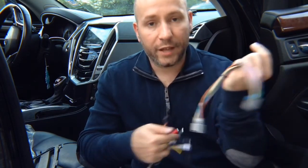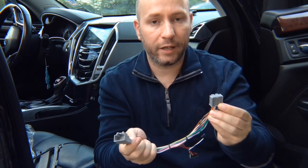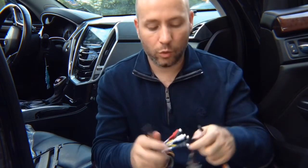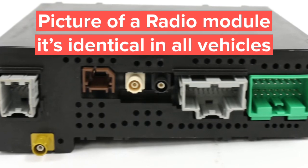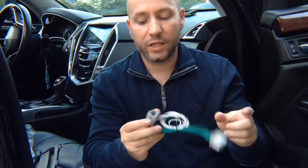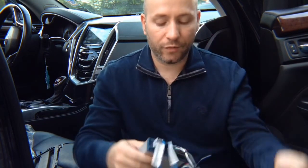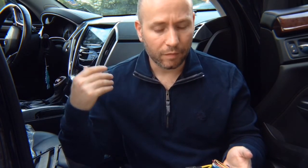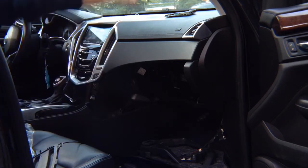Then you have this harness. You'll find a harness connector at the screen module — unplug it, plug the factory connector in here, then this goes back into the screen module. You have two connectors: one plugs in here. Then you have a second radio module — unplug the connector, plug the factory in here, and this goes back into the radio module and joins with the other harness. The entire installation of this module takes approximately five minutes after you access the radio. The radio and screen module in most Cadillacs and Chevys are behind the glove box. If you don't find it behind the glove box, refer to the manual — it's either in the passenger kick panel or the driver's kick panel.